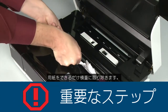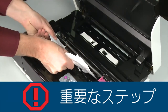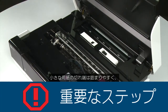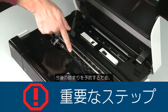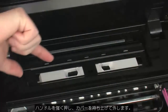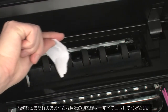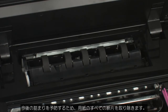Remove the paper as carefully as possible. If any torn pieces remain inside, more paper jams are likely to occur. Small pieces of paper can easily stick in places that are difficult to see — thoroughly search left and right inside the printer. Searching the carriage path is an important step in preventing future jams. Locate the paper path cover in the back of the printer, squeeze the handles and lift the cover to remove it. Carefully remove any paper you see, making sure to get all small pieces. Check the rollers and wheels for any remaining pieces of paper — you must remove all scraps to prevent future jams.